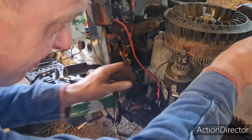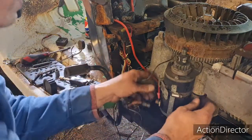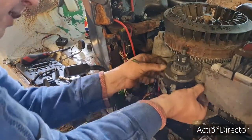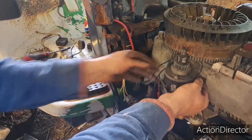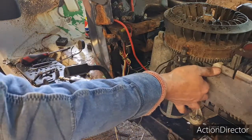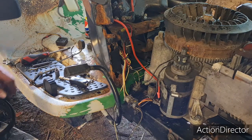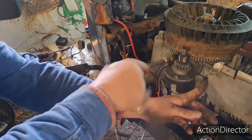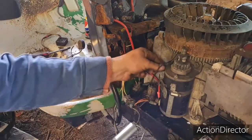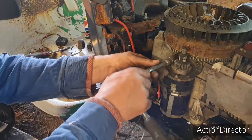I'm going to put this kill wire around the back of this starter where it should go — it should go around the back of the starter, but last time it got trapped in the engine block. Right, that kill wire is on now. Come on, get back up there — that's loose now. See that wire is loose, we can wiggle it. So if I hold that up at the top and tighten the starter bolts back up, I think we're going to be golden. I want to make sure it goes loose around the back — before it was coming down the bottom and that's what got nipped.